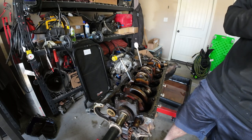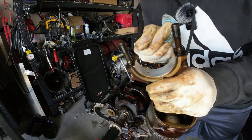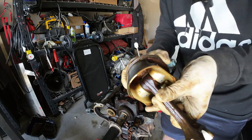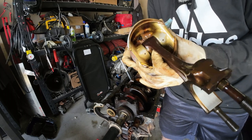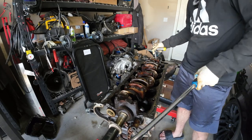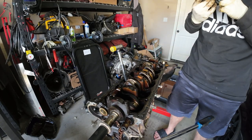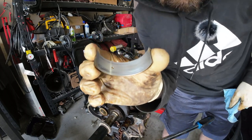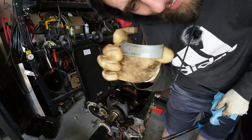There's some water in this bearing — so it was totally mixing oil and coolant; that's probably why cylinder 2 was a mess. This one's a little pitted, some light scoring, light wear. Some vertical scoring — oh, this oil control ring is seized. Actually not seized, just a little gummed up, not moving as much as it should. Just old.